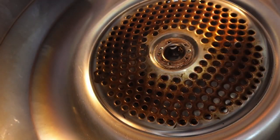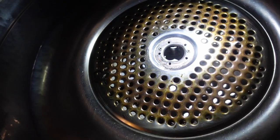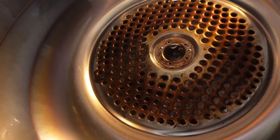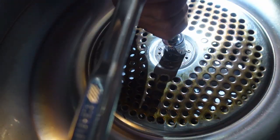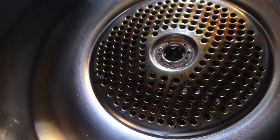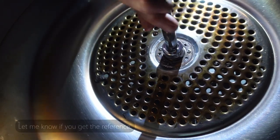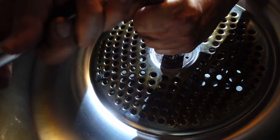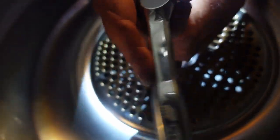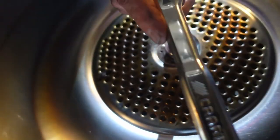She's had some wear. That kind of makes sense — there's some wear on there, that's why it was so attached. I don't know if that piece even needs to be replaced; I just want to see if this will let that get in there. One of the things that we found so difficult was trying to get the dryer drum supported in the right place while doing all this. It would be better if you ever have to do this to turn it on its side so that this bearing is on the bottom.